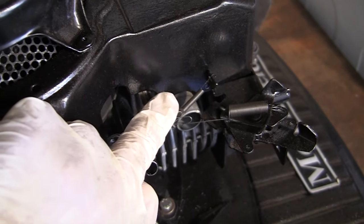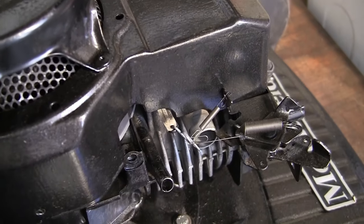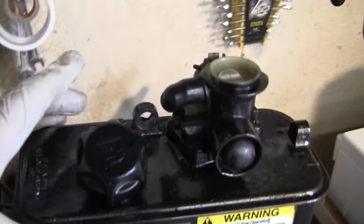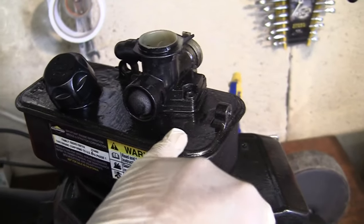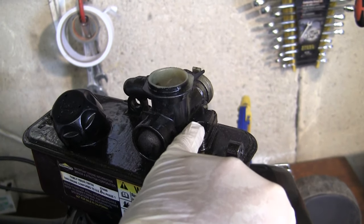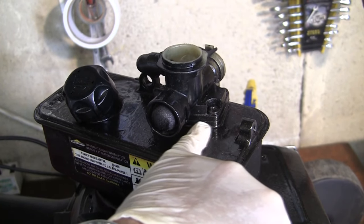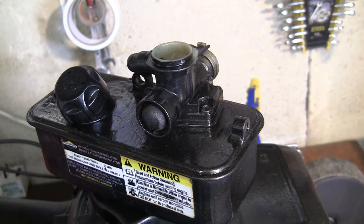Just bear with me for one more minute and I'm going to show you exactly what the cause of a lawnmower that's revving up and down is. That's where the springs go, but whatever you do with these — however you want to tie them up or try and bend them or stretch them — it won't stop your lawnmower revving up and down. If you've got this type of engine, which is a standard Briggs and Stratton engine, probably a 35 Classic engine, it will have this kind of setup on the top with the actual petrol tank here and this carburettor. There's an actual little gasket that sits in here, a diaphragm and gasket, and that's what pumps the fuel from this carburettor into the engine and makes it run. If this gasket's worn out — it's very thin and it kind of vibrates and transfers the fuel through to the engine — if it's got a bubble in it or it's old or it just doesn't transfer it properly, you'll have a lawnmower that just revs up and down, hunts, surges and eventually stalls and dies.